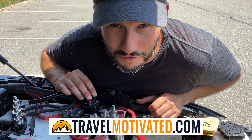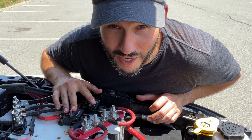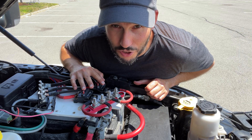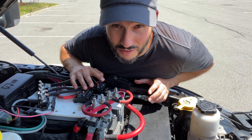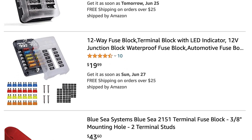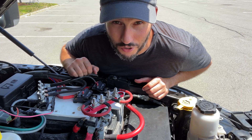This one is fine, but this one constantly trips even at low temperatures, so I think it's just starting to fail. But it highlights the fact that using breakers in the engine bay doesn't always work - it gets too hot and they trip. My solution is to use fuses, and after a lot of shopping I found exactly what I was looking for: inline fuses called terminal fuses.